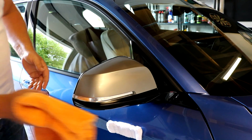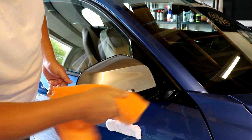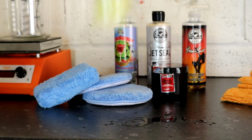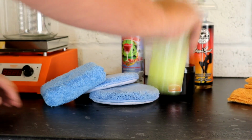But when you add that emulsifier, wax and water typically will not mix, and if you put the two together, they'll be separate, okay? They will not mix. The emulsifier allows the water and the wax to mix together. So the number one downside of any wax emulsion product or a wax blend with an emulsifier in it is that wax's ability to repel and resist and not mix with water is slightly compromised. And therefore, when your car is outside in the environment and it's getting rained on and you're washing the car, the resistance of the product to that water is reduced and the product quite simply will wash away quicker.